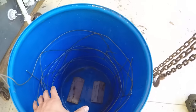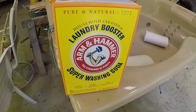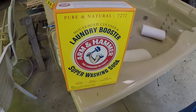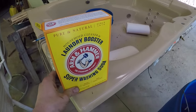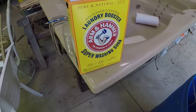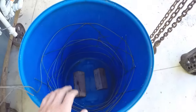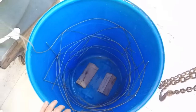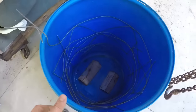Once you put this in there, you'll fill it up with water and then add some of this Arm & Hammer washing soda — it's not baking soda, so don't confuse it with that. This helps the water conduct electricity better and actually clean your part. I'm going to hoist this engine up and put it inside this container, then fill it up with water. I'll probably add the washing soda as I go to make sure it mixes in well.